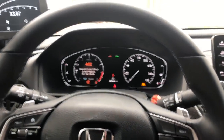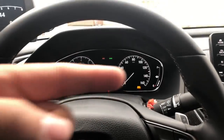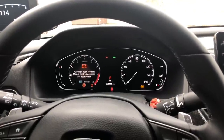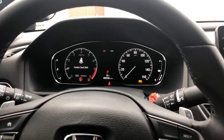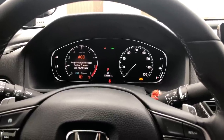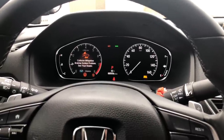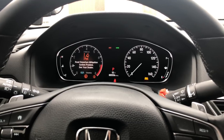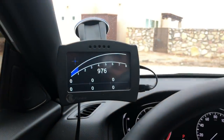Cool, so most of those indicators went away. Now when it comes to your adaptive cruise control, you're going to see right here it says brake system warning, auto high beams, collision mitigation, things like that. So again, those sensors need to learn that they're not broken. As soon as you drive your first 500 feet, they all go away — everything returns to green, no problem whatsoever. You don't have to go to the dealership. You literally just have to drive 500 feet.